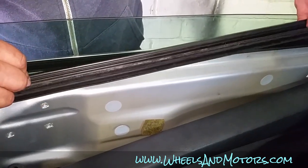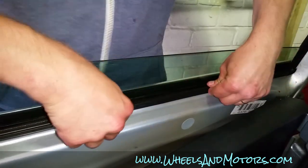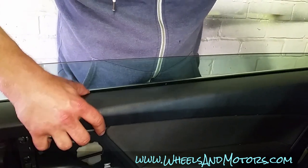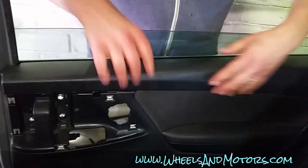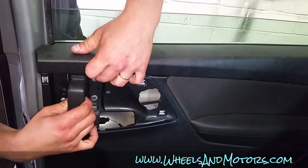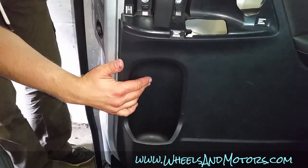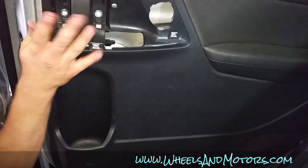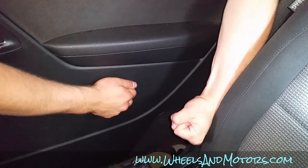It's a good chance to clean out all the dirt that gets in between the window seal — went and washed it. Now put the top of the trim over this edge. Then locate these clips, push the pin, and pull it up into position.